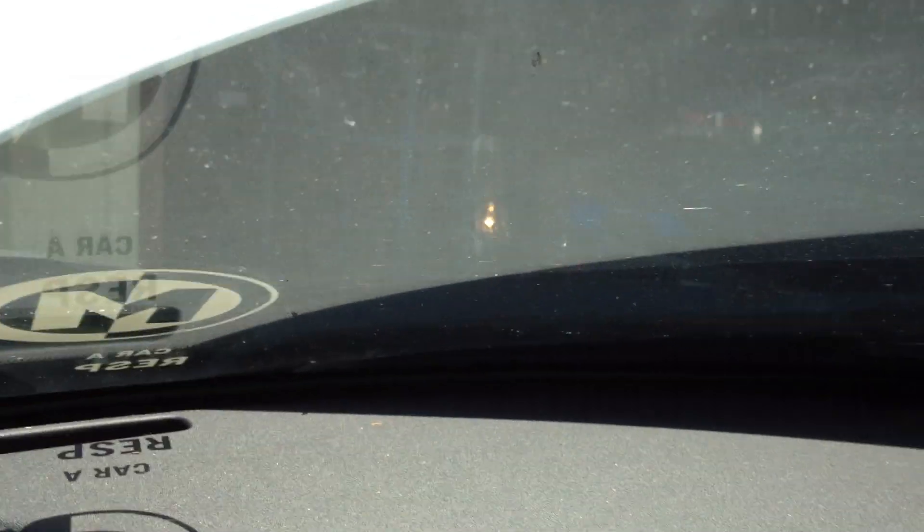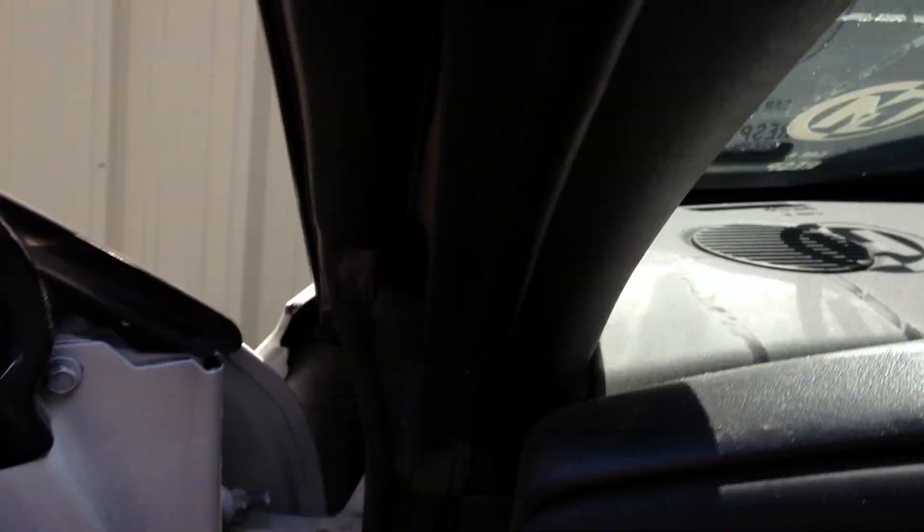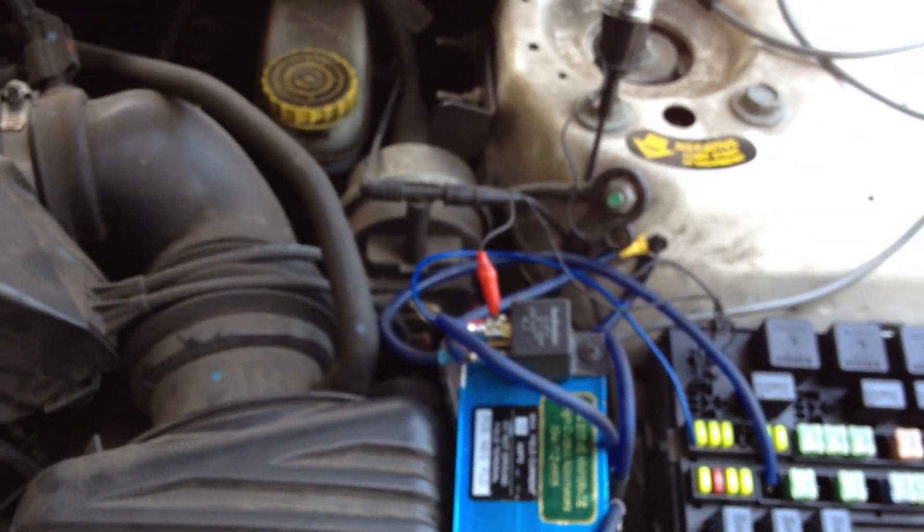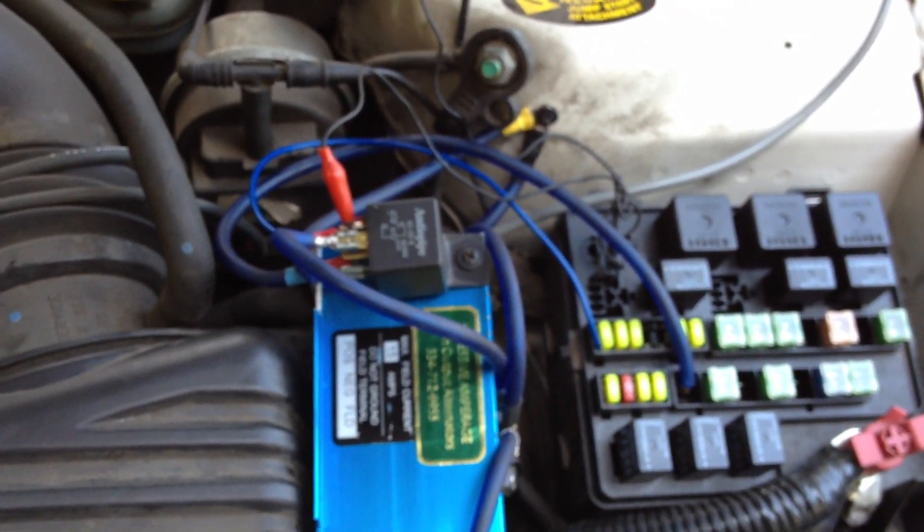Using Isaac's Sebring here to demo with. But as you can see, the light comes on with the key. Switch the key off, your power goes off. So there's your 12-volt ignition. That's pretty much it as far as hooking up the relay. Remember, you don't want constant power on that one — you only want it when the switch is on. That's what's going to cut your voltage regulator off and on.